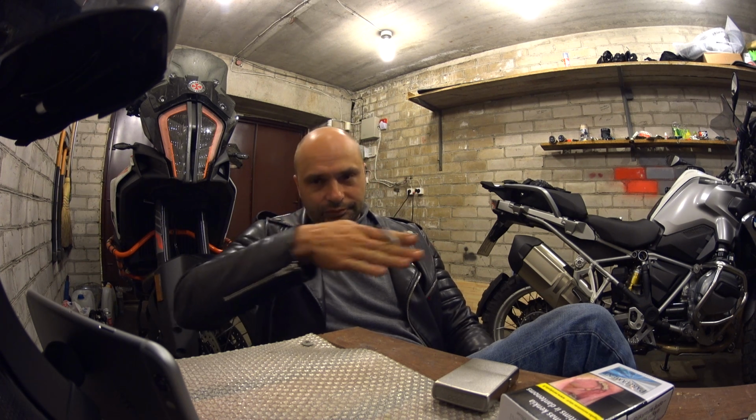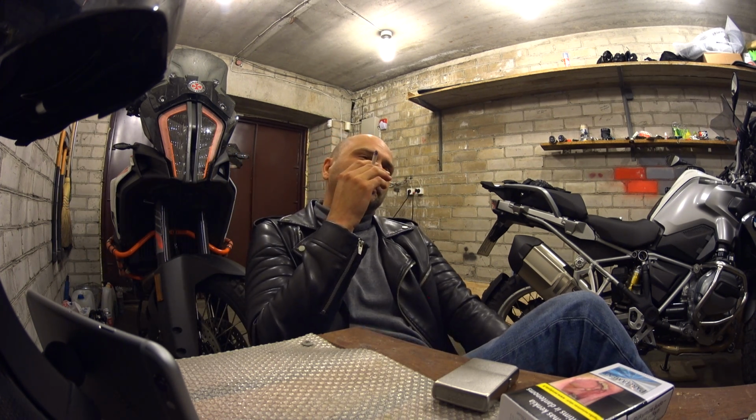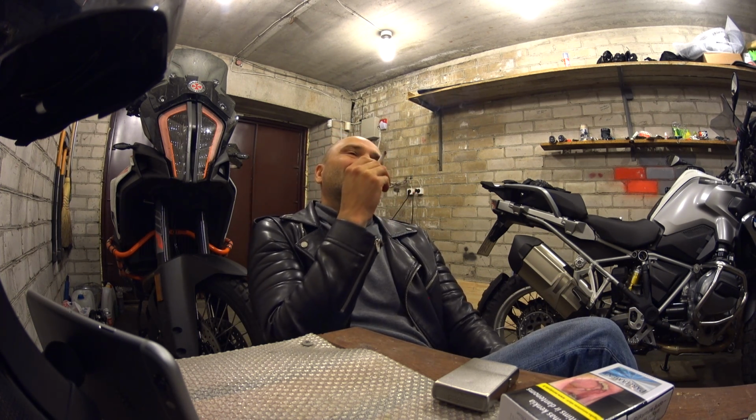And because of the front suspension, and how that front dive is not sufficient, and hard forks and the compression damping, or maybe the oil level is not right, I think if you disable ABS and you try to brake into the turn, enter the turn on the brakes, you may lose the front really easily. This is what may happen on this bike. This is just my prediction. I didn't try it, but this is how it feels.